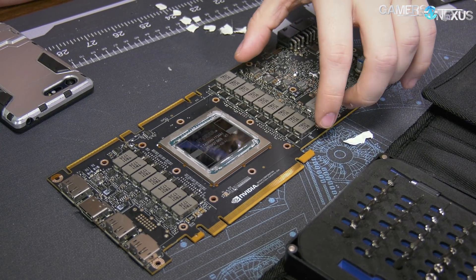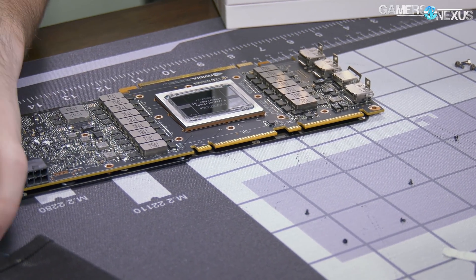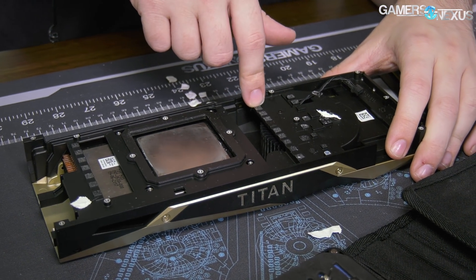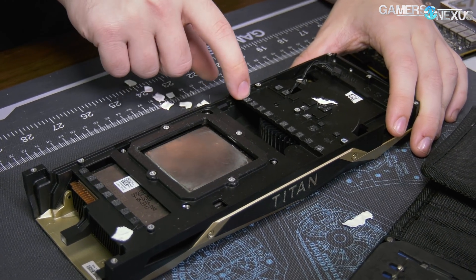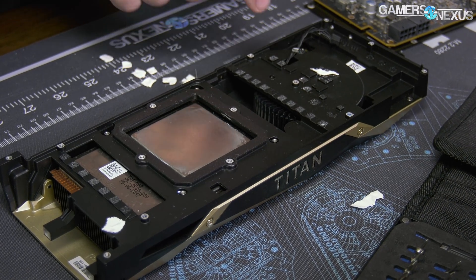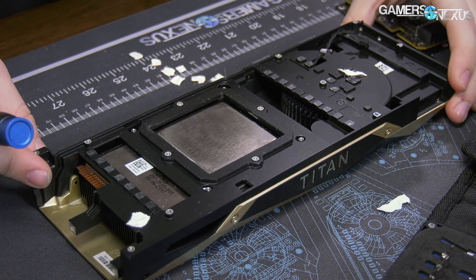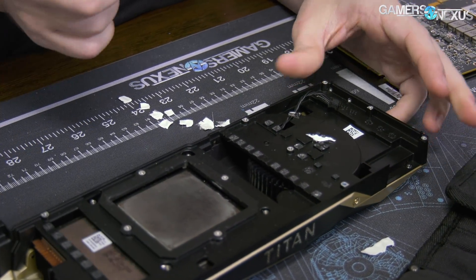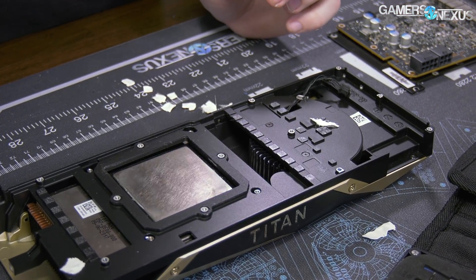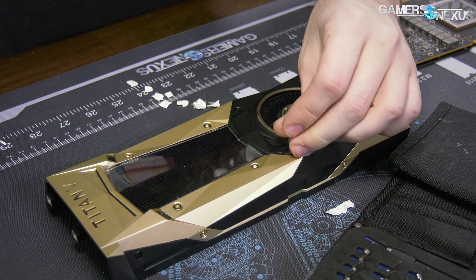The core layout is 16-phase and then we've got another phase over there as well. Let's take a look at the cooler — something I know more about. Buildzoid's got the PCB, I'll take the cooler. The base plate mounts directly to the PCB. You can see individual standoffs — these are raised from the aluminum base plate and connect directly with the MOSFETs and other board components. We have some raised elements over here as well connecting with various inductors and MOSFETs, and a couple of caps are connected to this plate. These screws here are for mounting the fan — if we remove that the fan will come loose.